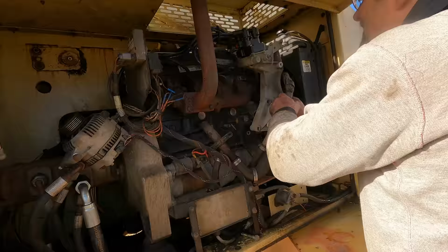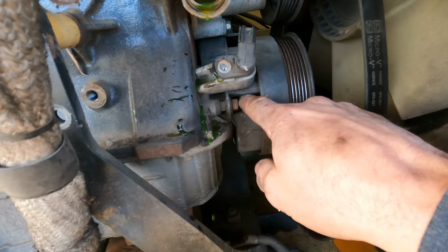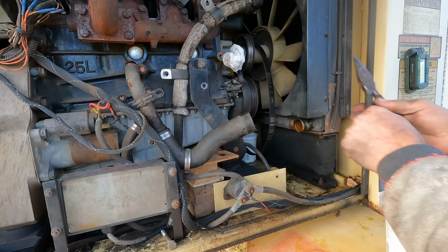And there it is. That's what I've been after. Had it loose and everything. That sensor is getting a signal from these teeth as they go by on that gear and sending it to the brain box, which allows it to set the timing and know the RPM and all that good stuff. After you get the bolt out, you should just be able to pull that sensor out of there, but mine wouldn't budge. Surprised?